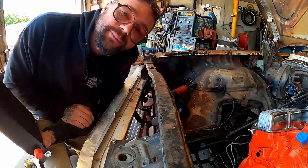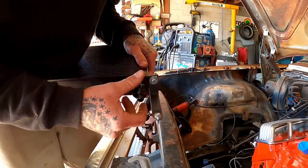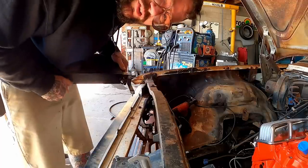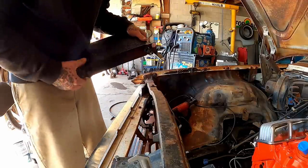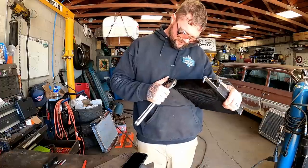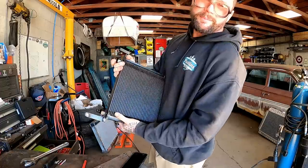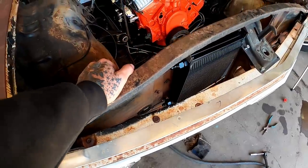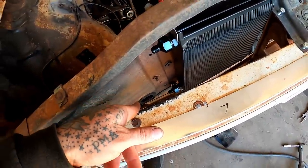It'd almost be impossible. Next, we'll pop our adapters on. I think these just thread on. That's all it takes. It's going to seep down there and seal up. And we're just going to use AN lines or fittings, whatever, to build our cooler lines. Torque them with the Pike County Speed Wrench, and now we can go torque this on the wagon. Ain't so worried about building the lines right now. They should just swoop right through that hole right there.